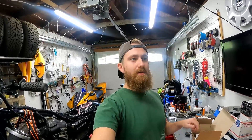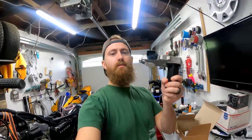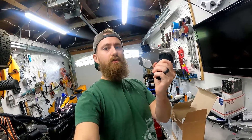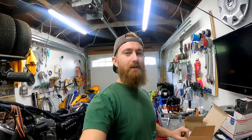This has unfortunately happened more than a few times since I've owned this truck, and I didn't buy it new, so that goes to show you. But every time so far it has been fixed by replacing this — the electronic motor that actuates the transfer case. I'm not sure why we ever went away from the manual linkage and went to a switch with an electric motor under the vehicle, but we're not gonna go there. Today we're just gonna get the truck back shifting into two-wheel drive like it's supposed to.